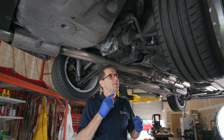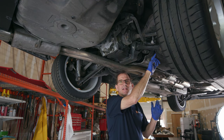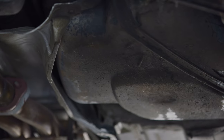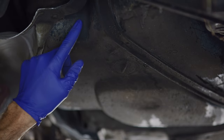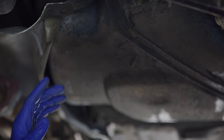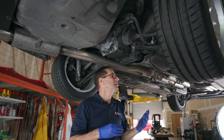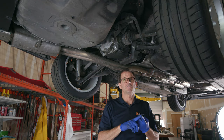So think about this. The car's brand new and they spray cosmoline on it. That means the surface was spotless, perfectly clean, and then had a coating put on it. So when I take that coating off, it's spotless, perfectly clean underneath. Well, if there are areas like right here where there's no cosmoline, and elsewhere it's spattered in there, and I clean that, it could look dissimilar. There might be a different look because some of it had cosmoline and some didn't. There are tricks we'll talk about to address that, and it's always related to client interaction.